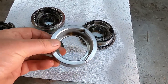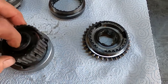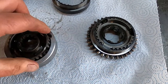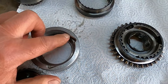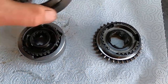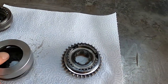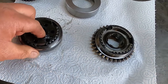This is a special assembly tool. The inner part of it has holes for the springs and balls which you align with a little cutout. First you put the springs in, drop in the balls on the end of the springs, then rotate it against a little ramp in here. That ramp then compresses the ball and spring all the way in. You then take the outer, align its cutouts with the cutouts on the other half, flip it upside down and push the inner through until it locks in place. That's the theory anyway.